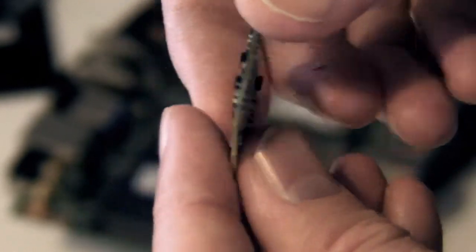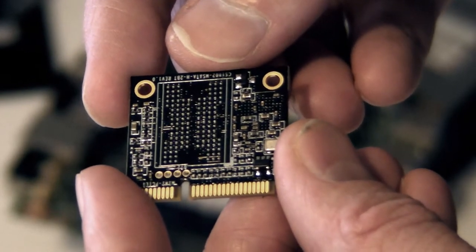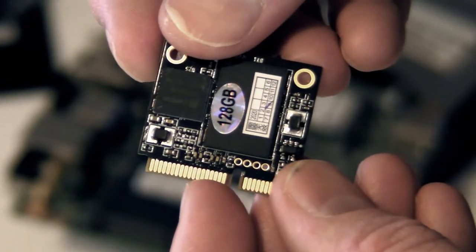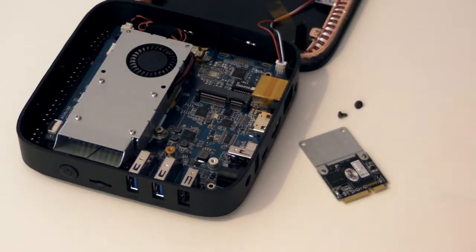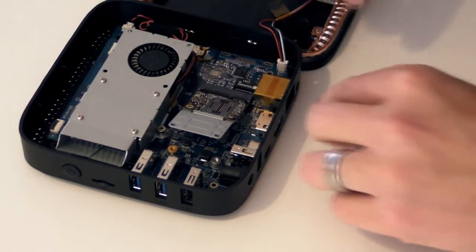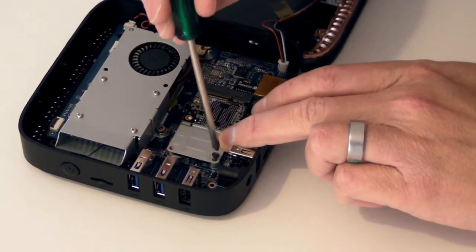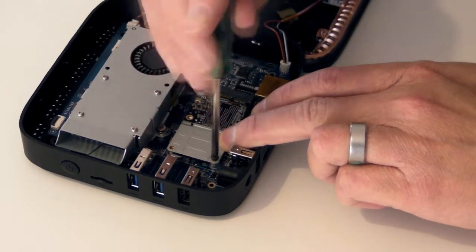While the SSD physically fits in many PCIe slots, these Kingspec SSDs may not work with PCs older than 2017. I tried this one in a 2009 laptop and several NUCs older than 2017 without success. In the end I put it in a late 2017 NUC with great results, though I had to attach an extension plate, which defeated the purpose of getting a half-size unit. I'd have been better off buying a cheaper full-size mSATA SSD for this particular NUC.